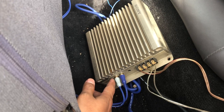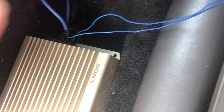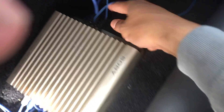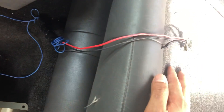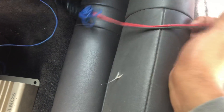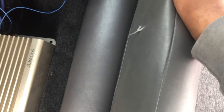I'll go over the wires again. These are your RCA cables — they go in the back of your stereo: the white one and the red one. Then your 12-volt is the one that's supposed to connect to your red cable for power in your stereo. Then the remote on the amplifier is for when you turn off your car — your amplifier and sub are going to turn off with it. I believe that's your yellow wire.